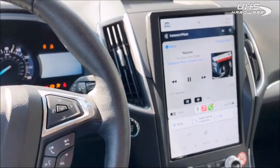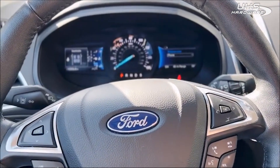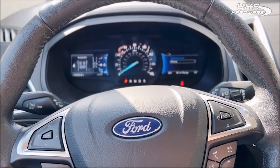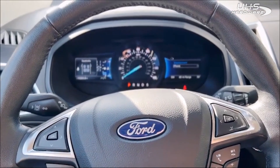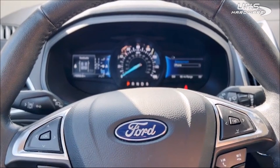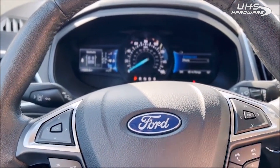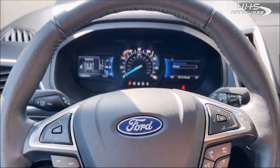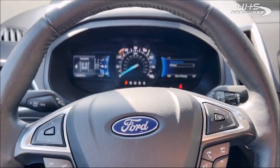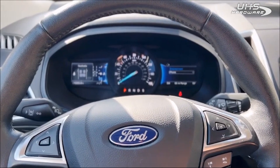So just food for thought: if you get this kind of behavior where the remote works but it only starts in the slot, chances are you have the wrong PROX and it's not the motion sensing PROX. The Edge, the Mustang, and a few others went to it — I believe the 2022 Edge was the first one. Again, check Josh Heath's book for a reference on that.